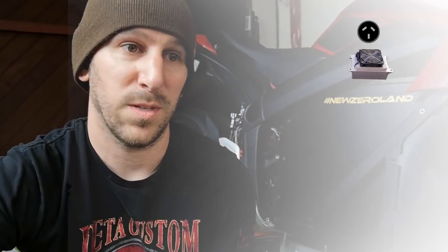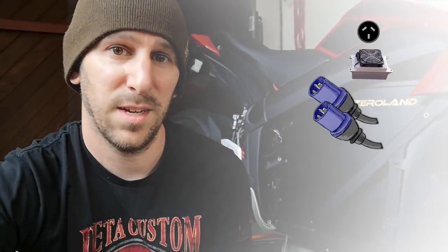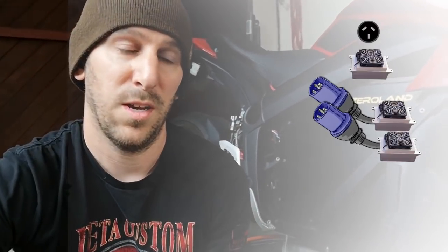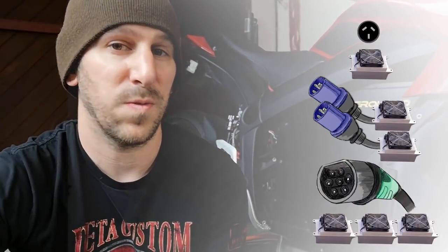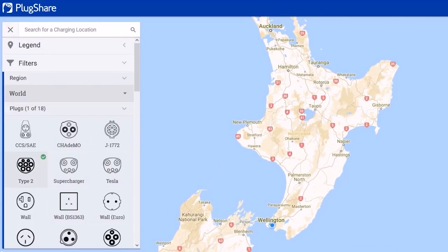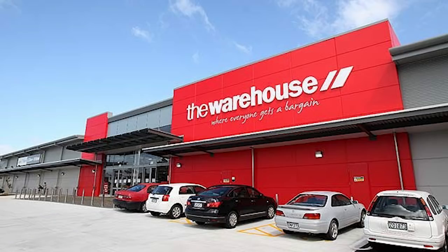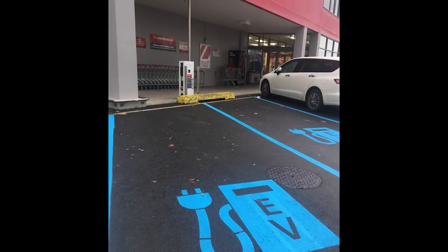If I wanted to charge at home I would just use one charger. If I wanted to charge at a campsite, where there's usually two blue commandos per campsite, I could plug in two blue commandos individually to two chargers. Or if I'm at a three-phase Mennekes station I could plug in all three. There are also single-phase Mennekes stations which are like seven kilowatts. If you go on PlugShare and turn on the Type 2 stations you'll actually see a lot, and this is thanks to a store called The Warehouse, which is kind of like Walmart for New Zealand.